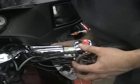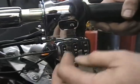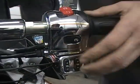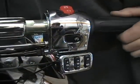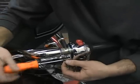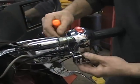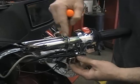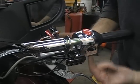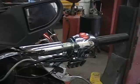Now, the next thing you want to do is if you have the controls here with the stereo controls and that, there's a Phillips screw right here. You want to take that Phillips screw out. Now your switch, the control unit here won't come off because it goes through the bar, but what it lets you do is now you can get to the screws in the switch housing. If you didn't move this, you couldn't get to those screws underneath there.